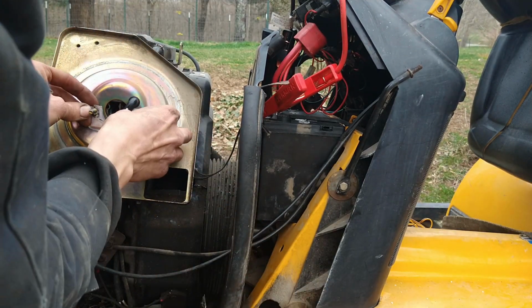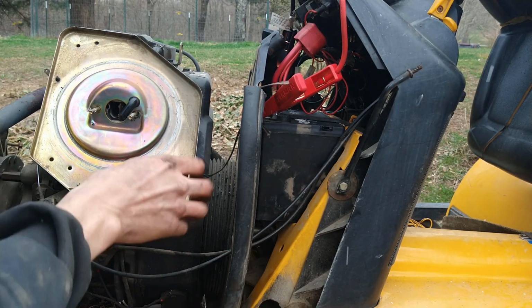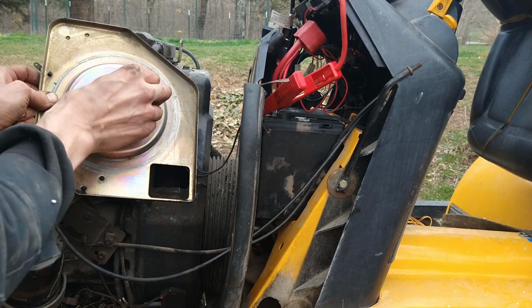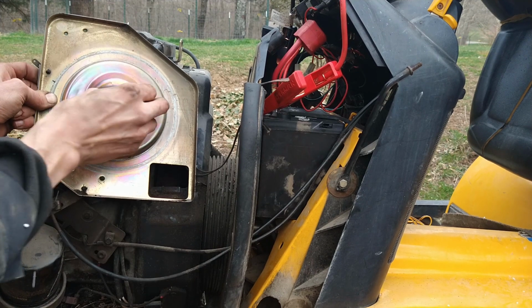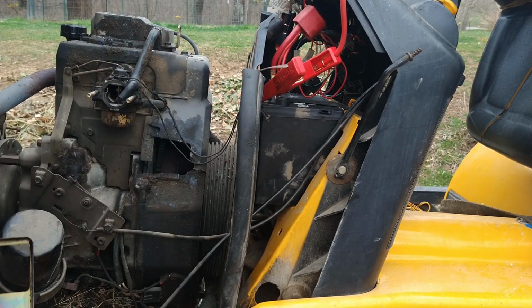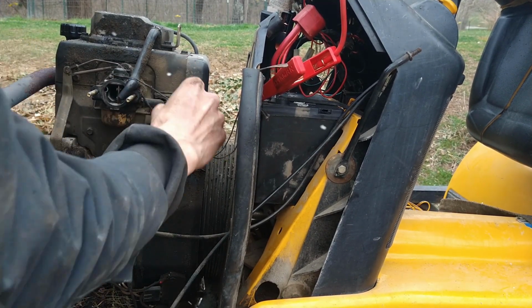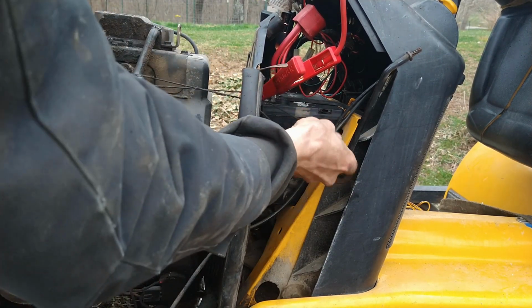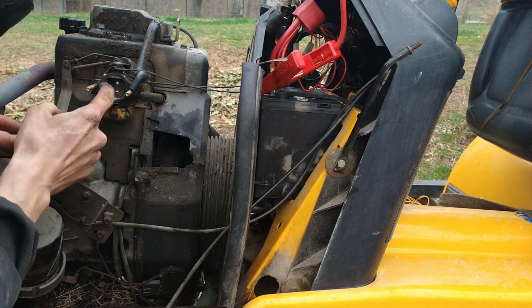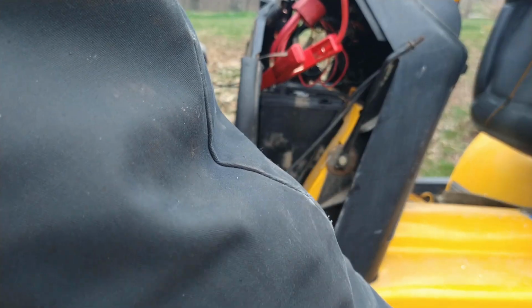All right. You like that? You like that gasket? That's pretty sweet. Doesn't look like we have a lot of blow-by, at least if this breather tube connection here is any indication. That's good. Engine internally might be okay. Yeah. So my suspicion was correct. This is a choke control. That is unbelievable, dude. Unbelievable. And inside our carburetor is rust. So this is not looking good.